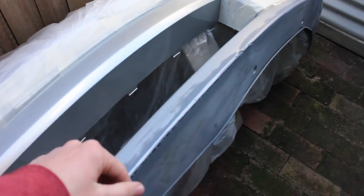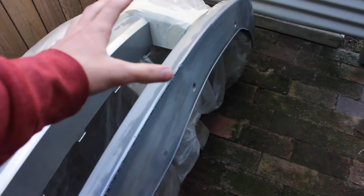The wind picked up a little bit so I've resorted to the bin area. My battery died so I went ahead and done some things off-camera. Pretty much I've sanded it all up, it's ready to be painted, all cleaned up with the wax and grease remover, then I taped it all up for what I want to paint and masked everything up. Then I cleaned it off again because the wind actually put a bit of dirt on it. So we're ready to paint — I'm just going to wait a little bit for the wax and grease remover to dry and then we're going to get into the first and only coat.